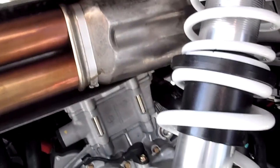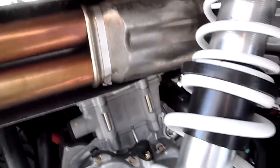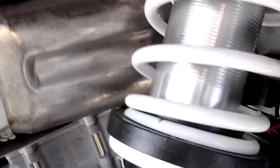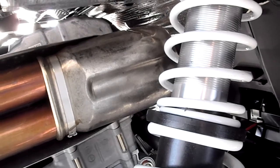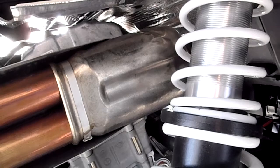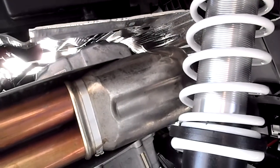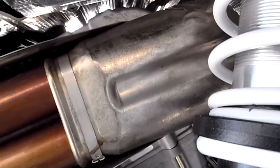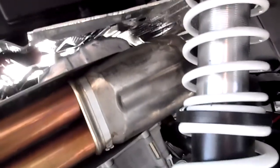After jacking up, I found out the reason for that spring and the reason you can't take it out. If you notice, you run out of thread, so you'd never be able to droop this out all the way without the spring falling out. You'd never be able to put preload on the spring by 2 inches. So this is a 17 3/4 spring.